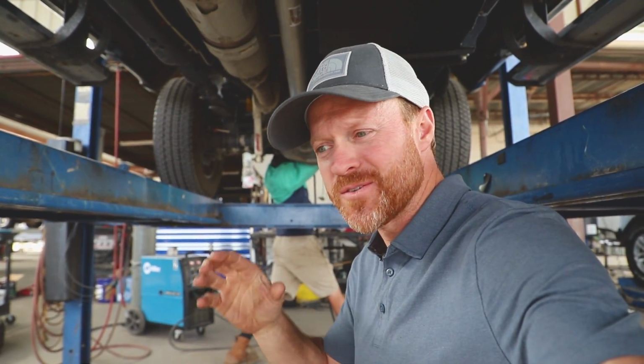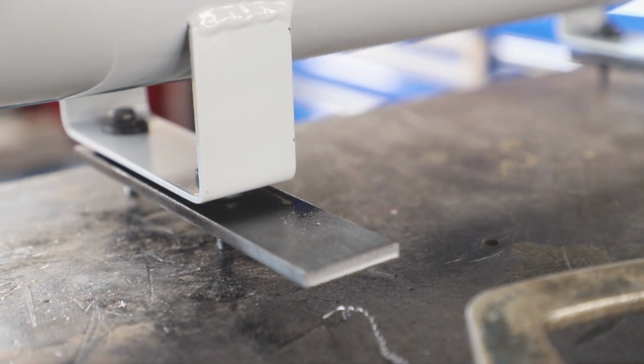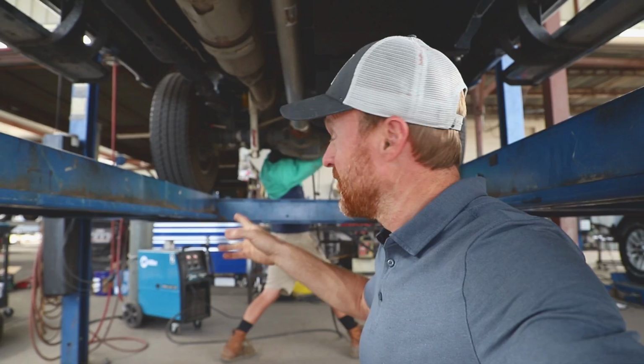All right, here is where the real time savings occurs with a professional install. Right now he's welding his own mounts to that frame. So the 2.5 gallon tank goes exactly where you want it in exactly the right position. He just took a couple angle iron, cut it off to the width, made his own screw holes, and put it right there.